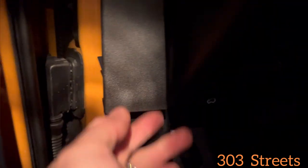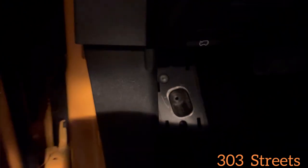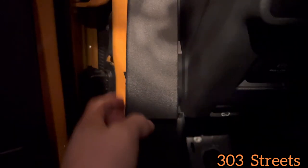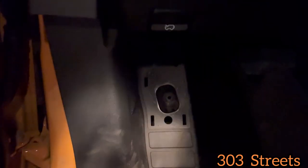There are two clips — it's going to be very hard to see. You can see where the two clips go in. So you're going to have to pry it out. Be careful, you don't want to break it. Take your time. And then the actual piece right here clips in at the back. Now that I have the two clips up here removed and the clip that connects into the vehicle, you can kind of just pry and pull out the rest of the kick panel.